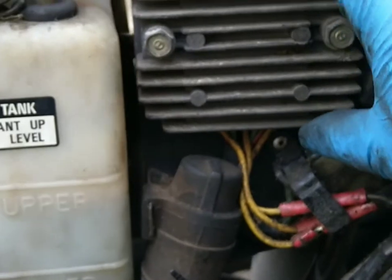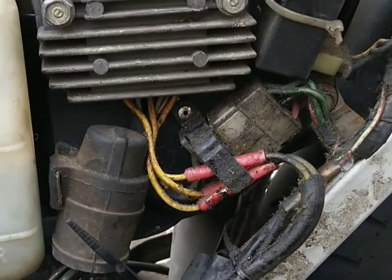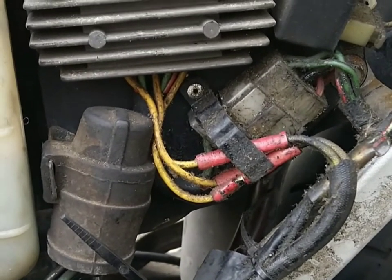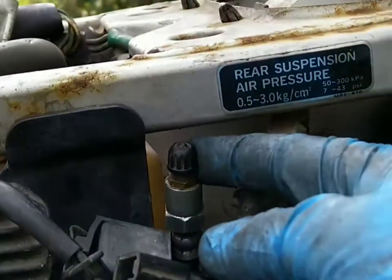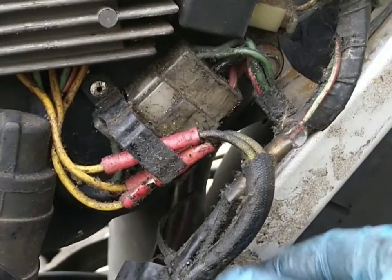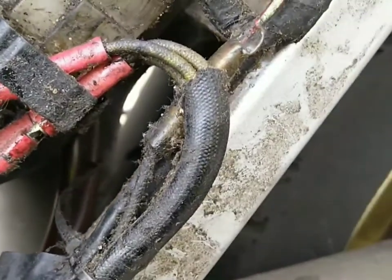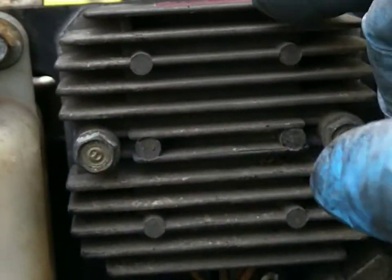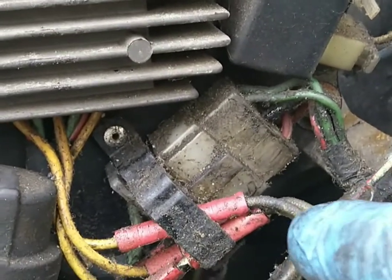So I had a kind of hard time getting this rectifier construction thing back in because I didn't realize the notch on the other side. Put a different cap on the air hose. You see, this has been fixed before by me because it was starting to burn out. A lot of people will blame these rectifiers, but this rectifier is actually still okay — it was just the wiring connectors that were burned.